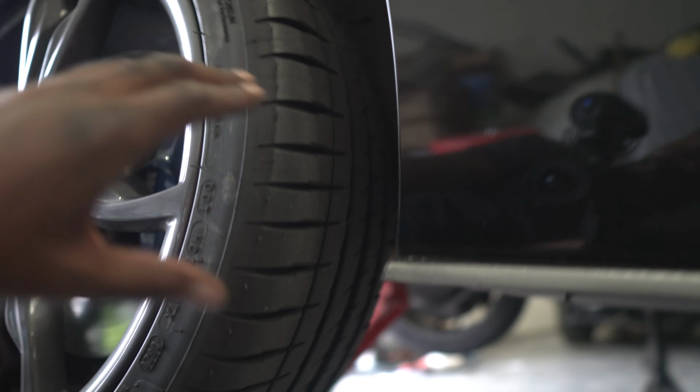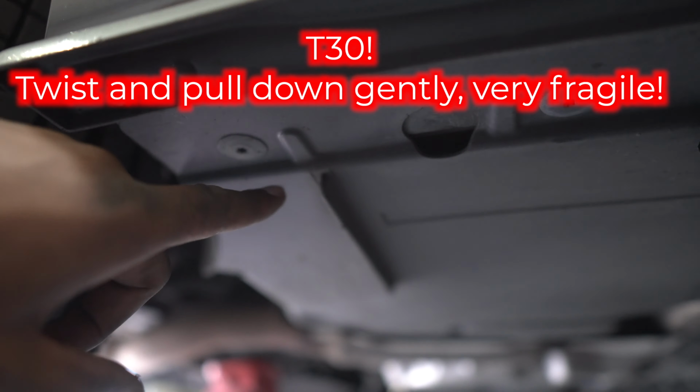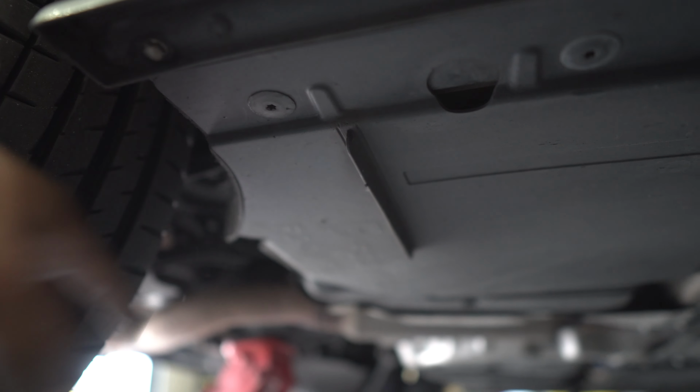Okay, so now here comes a slightly trickier part. So the rears have been done. Obviously we haven't torqued them down yet because we need to tilt the subframe forward, but in this little panel here, just by the wheel area, you can take your wheel off, but I'm going to try and do it without anyway. You've got to remove 2 of these Torx screws that are under here, and then that should allow you to bring this flap down. I believe it's just 2 anyway.